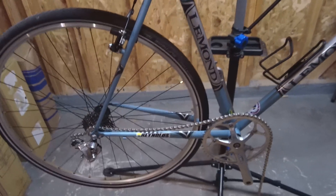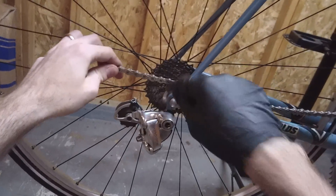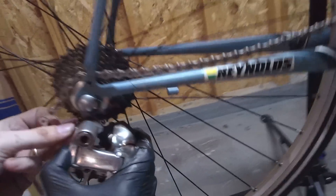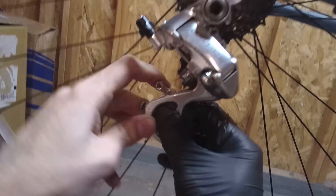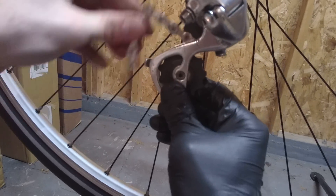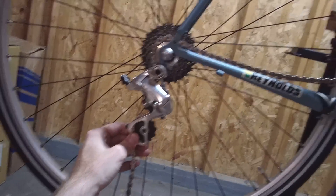Now that I've got the chain on the bicycle, how do I route it through the rear derailleur and over the chain wheel? Simply take the bicycle chain, run it over the chain ring, all the way over to the rear cassette on the small cog, pull down on the rear derailleur, route it over this top pulley, through this tab, over this lower pulley, and then down through this tab sticking out on this pulley. Notice we get sort of an S-shape going through, and then we can reattach the chain.